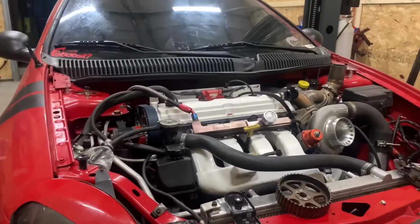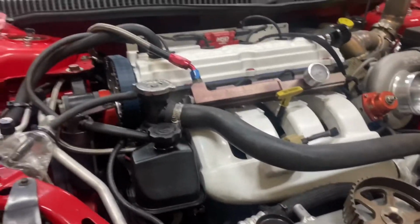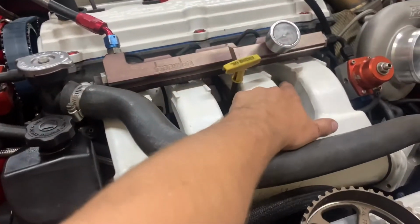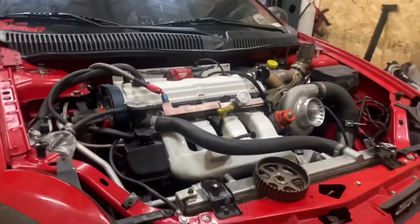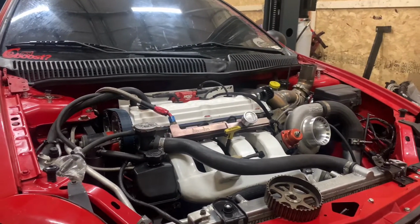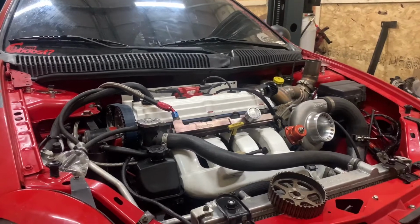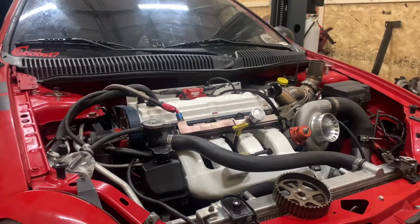So apparently I got lucky. I don't know why it failed the leak down test so bad, because I had the cams out of the car and cylinder 4, you could hear it hissing air, and I sprayed soapy water on it, and you could see it bubbling out of that one. And that's the only one I checked. Once it failed the one, I started pulling everything apart.